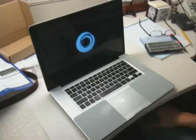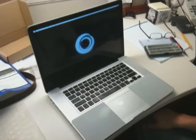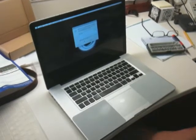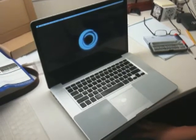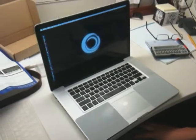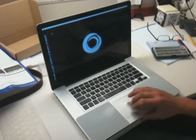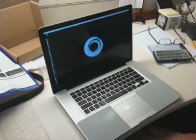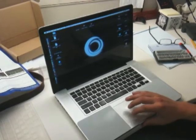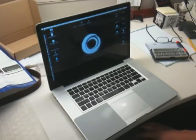The machine wouldn't boot if the RAM was installed incorrectly, so you know at least some of the RAM is working. Now we have to check if both memory modules are active — we know at least one must have been active. Make sure everything loads.